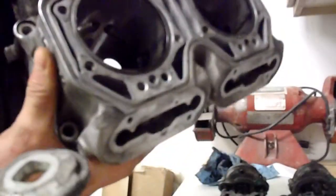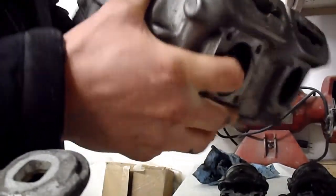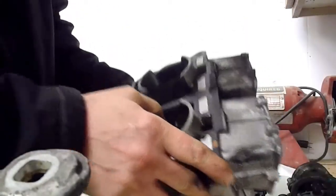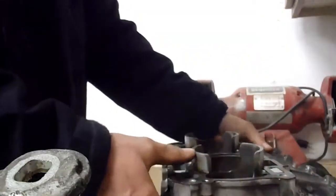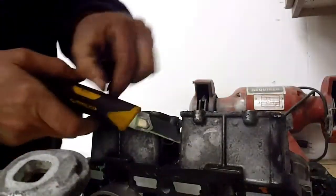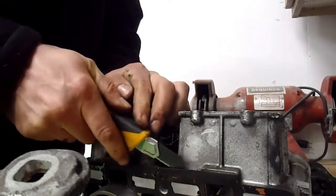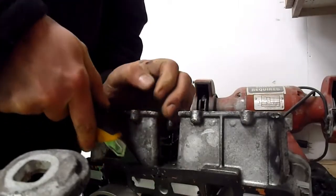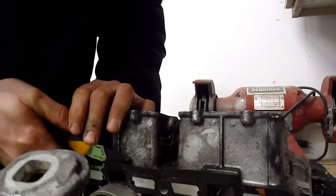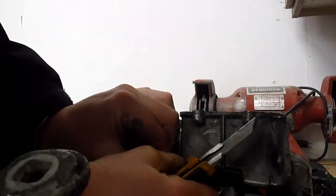The reason why I wanted to get those apart tonight is I'm going to take this monoblock down to work and I'm going to be cleaning it up — I'll take you with me on that. First just need to do a really good cleaning on it, and then I'm going to do a little bit of port work and stuff. Get these gaskets cleaned up. I'm going to keep this part of the gasket in particular because that's going to give me my thickness — those holes in the gasket are going to indicate how thick it is. Your new gasket kit should have different thicknesses.